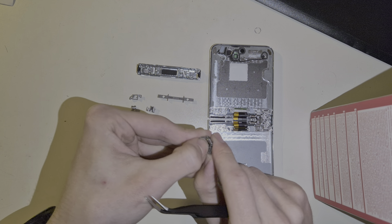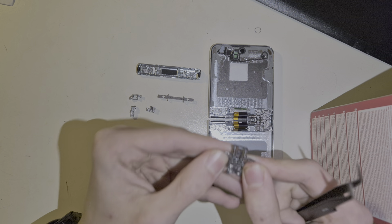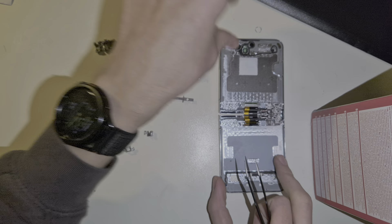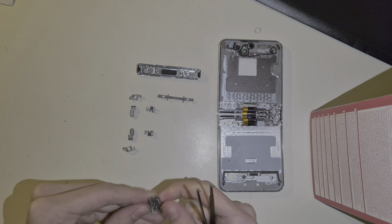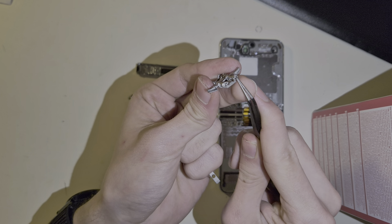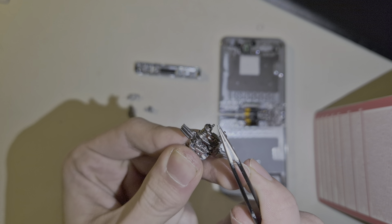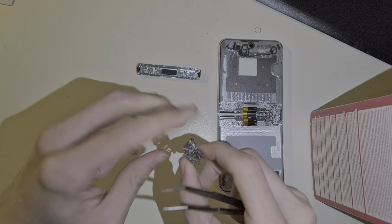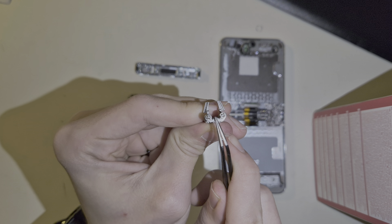And this is actually enough so the phone can keep in a half-opened or half-closed state, like this. Another pretty nice thing — when the hinge itself is opened, you can see on the other side of the spring there are those two little nubs. One is here, one is here — they're in the top center of those two springs. If I now close the springs, they're in the bottom center of those two springs.